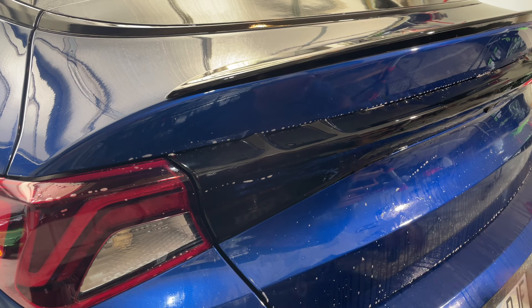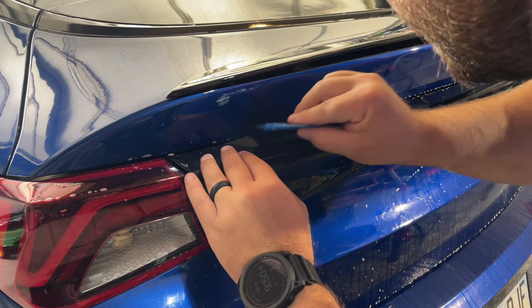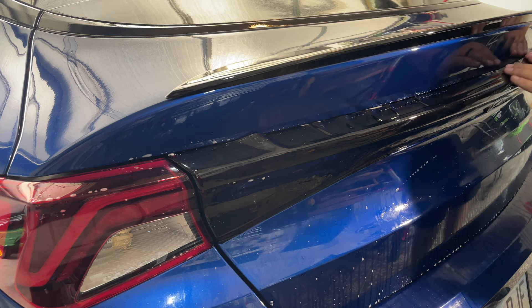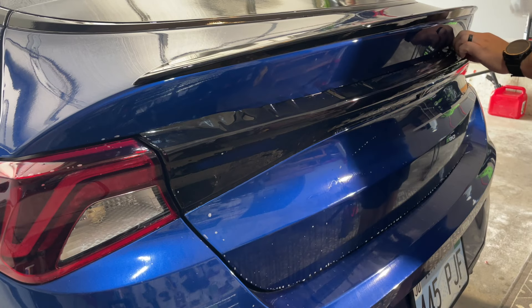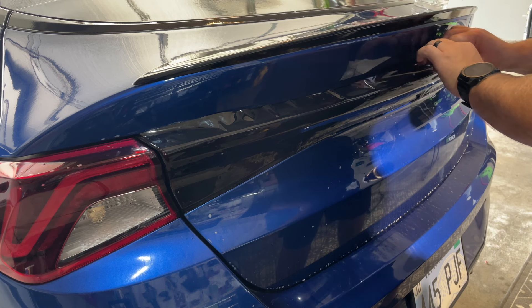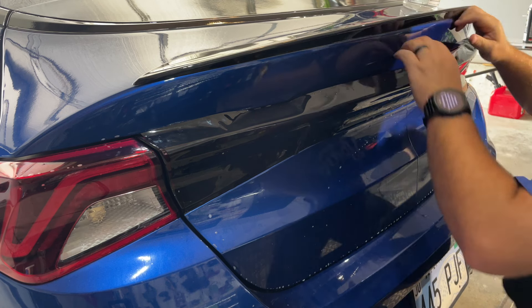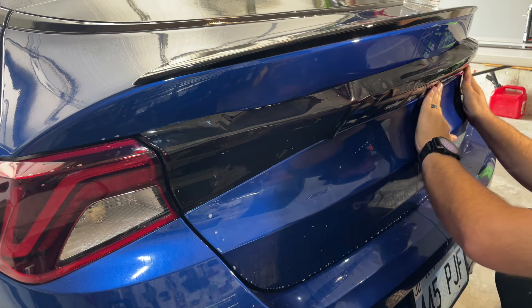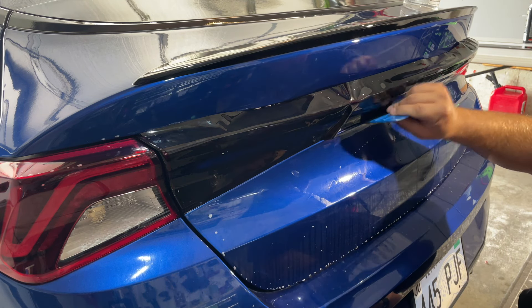We're a little short right here and we've got some fingers. What we'll do is gently pull and stretch that vinyl so we've got full coverage. Whatever vinyl this company uses is really easy to work with - it almost reminds me of window film but way more stretchy. Now we'll start getting some of these fingers out, get them out up top. We're going to need to grab our tack solution because we've got a lot of fingers up top.